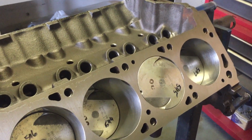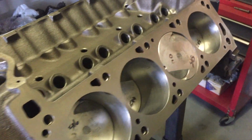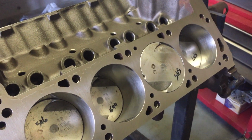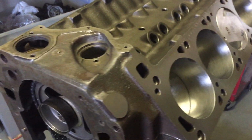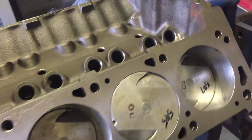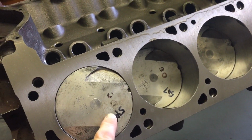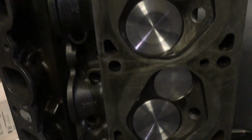And so instead of using a lumpy top piston like in a Boss 351 in America, they just did their own thing, machined the block, used the cast pistons that came out of that original engine, put them back in, and so they had a flat top. And I don't know if they knew back then, but having a smaller quench area here in the piston, a narrower quench area between the flat spot of the cylinder head, and let me just show you the flat spot in the cylinder head that I'm talking about.